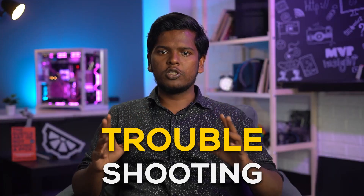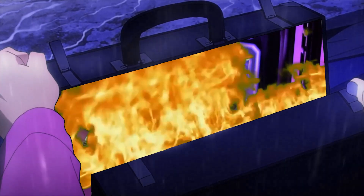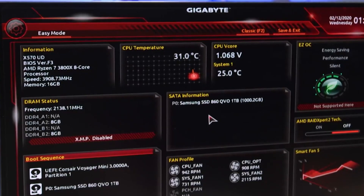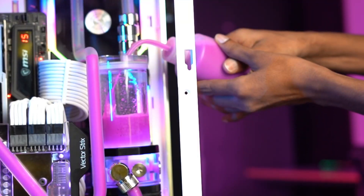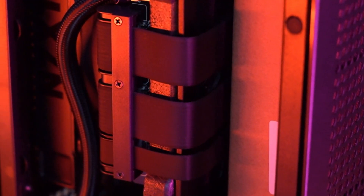Now the worst part: troubleshooting. In case any of your components turns out to be faulty, pinpointing the issue and even getting it changed can become a huge challenge. Check boot before you even start looping. For example, this build was done 3-4 days ago, but after the loop was done we weren't getting any display. If the build worked before looping and it's not working after, usually only one thing can go wrong — a leak. But we did our troubleshooting: we had to remove the entire liquid and let it dry. After testing, we realized the riser cable of the GPU turned out to be faulty. These are all the challenges you will have to go through if you are thinking about a liquid cooling build.